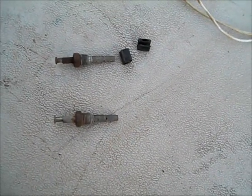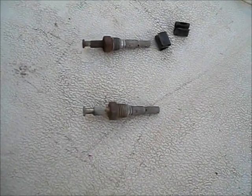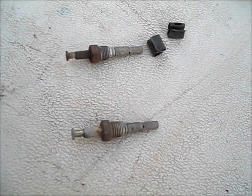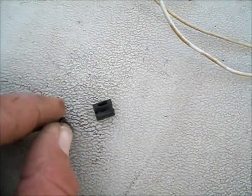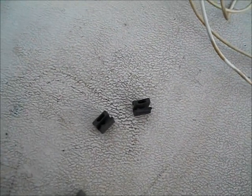If you're going to pull these out of a parts truck yourself, here's what you'll need. You need the door switches — they just unscrew with a 7/16ths socket out of the door jamb. Then unplug the end from the wiring harness and pull the harness through. You want to take the complete harness — unplug it, nothing to cut. I recommend getting the clips that attach the wire underneath the glove box as well; they'll come in handy.